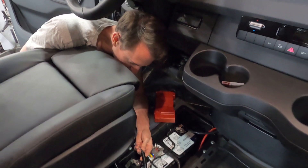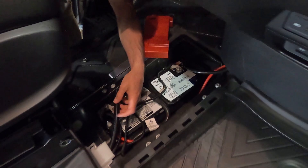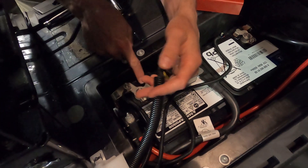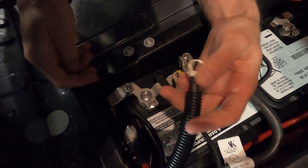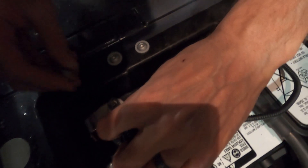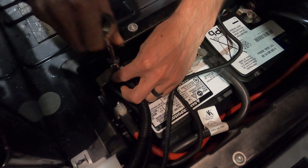I ran my 6 gauge wire back to the DC charger. I found a connection here that I'm going to add to the positive terminal of the battery — it's connected by a pretty solid terminal there. There's already a wire there; this was all existing already. So I'm going to add this in and then screw that down. Make sure you screw it down nice and tight.